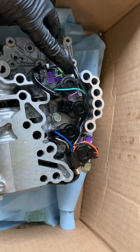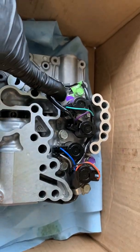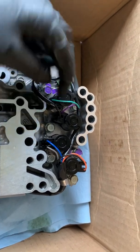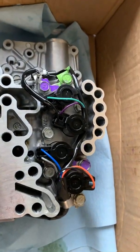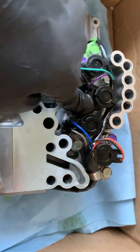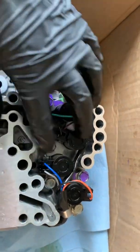So some things to keep in mind: the green bolt is your shorty bolt; the long bolts in purple have the nut and go all the way through. The purple one is to the left of your torque converter lockup solenoid — that one has two grounds going to it. The other purple one has no grounds but goes all the way through with a nut on the other side. These other four are the same length, which is why I haven't marked them — they're medium size and just bolt straight in with the hold-down plate going over the top of the solenoids, holding them all down.